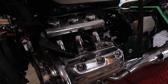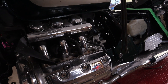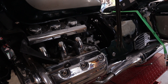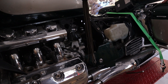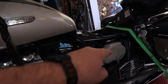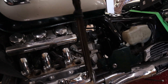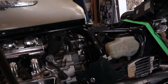Today I'd like to make sure this engine turns over. I have oil, a filter, and Marvel Mystery Oil. We can put the battery in, get the bus bar attached, and start putting things back together — but I want to make sure it cranks and fires first. The first thing we need to do is get that bar situated, get the battery in, do a test crank, and then re-hook all his electrical accessories.